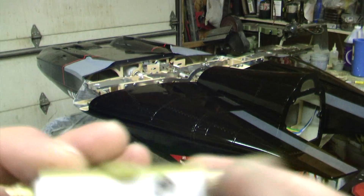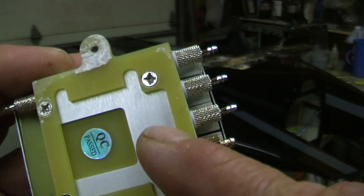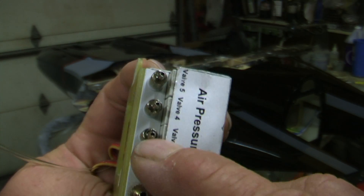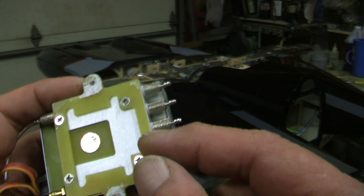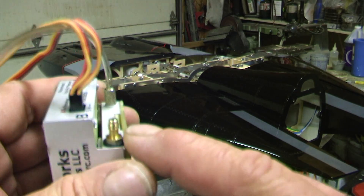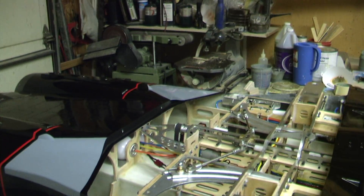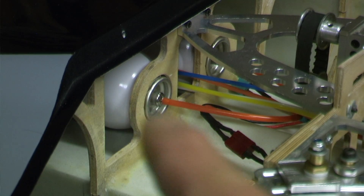The fitting went in deep enough. When you unscrew these they're pretty long, and down inside this aluminum it goes way back. There's a pretty good size hole, but the big restriction is these little tiny holes here. I ran my bit just down to that little lip inside and drilled and tapped and screwed it in. I was one fitting short, so I went to the hobby store, got an 8-32 pressure tap, did the same thing on the other side, and got the air tanks installed. They both have the four millimeter line.